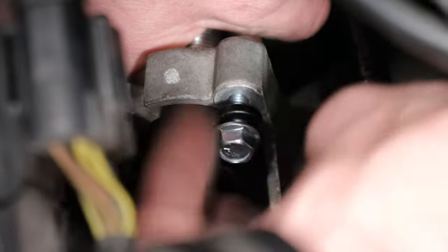Now inside the car, it's time to install the shifter cables back to the shifter. Install the shifter cable onto the shifter using the supplied pin. Rotate the other shifter cable end link so that it lines up correctly with the lower section of the shifter. You can thread the nut back in place and use two wrenches to tighten it together. Once it's tight, you can install it onto the ball at the bottom of the shifter.